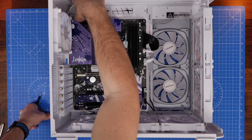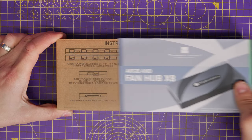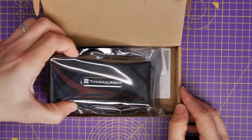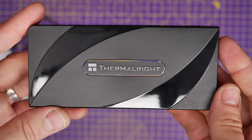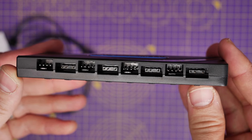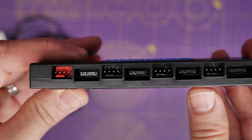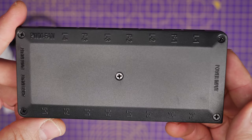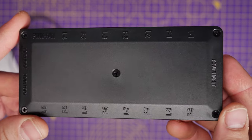The bottom 120mm fans use the long screws from the accessories box, screwing in from the top rather than from below. These are standard-blade fans face-down for maximum airflow onto the graphics card — if you want RGB, reverse-blade fans would look nicer. With front, side, and bottom fans all set to intake, plus a 120mm rear exhaust fan and exhaust through the radiator, we'll have four exhaust fans and many intake fans for cool air. All this intake leads me to recommend the Thermal Right fan hub, which controls RGB and fan speed for up to eight fans easily.